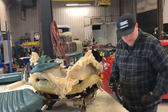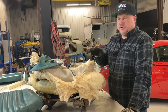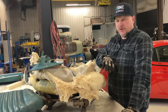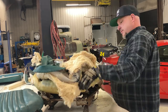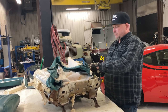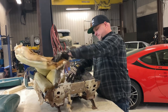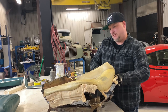As I'm pulling this apart, you can see they had padded this up — this pads the bolsters up. One thing I always tell people: whenever you buy a kit, you should always buy the foam from the same manufacturer you got your kit from. Even though they're supposed to be exactly off the factory spec, I've found that if you buy one specific interior kit and someone else's foam, a lot of times it's kind of baggy, and then you're resorting to overstuffing it — kind of like this. This is overstuffed here. We're going to be replacing this foam.